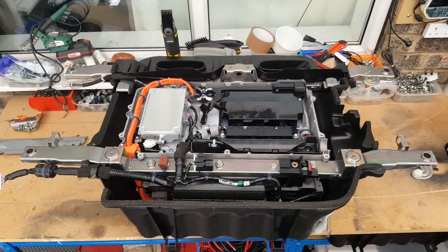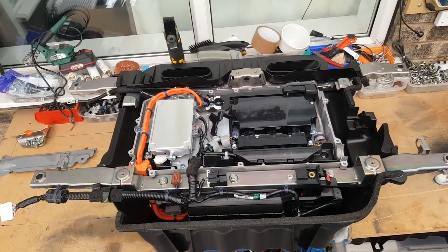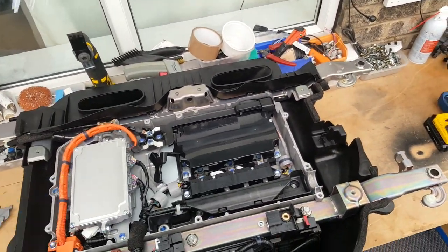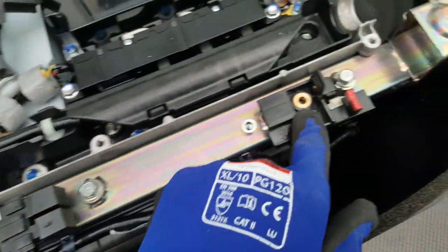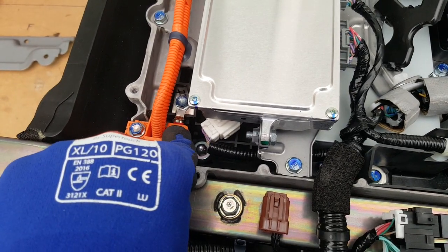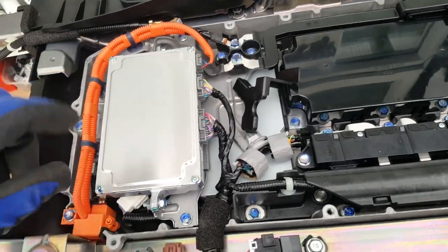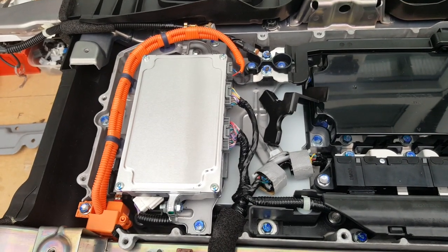What I was interested in initially was to see whether we could access the right parts of the battery without having to take it all out of the car and remove all the interior trim, which I really didn't want to do to my nice car. By just taking the cover off and having a look around, I've found that the main positive from the battery is down here, and when the switch is in the on position — which it normally always is — this is live from the positive. The negative from the battery is here, and these two wires don't pass through the current sensor or any of the other sensing, so the car won't know about any power we're feeding in or taking out at these points.